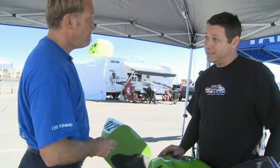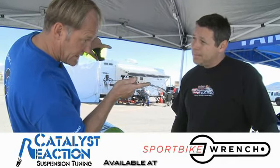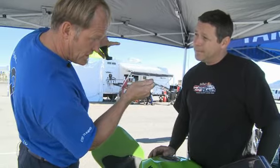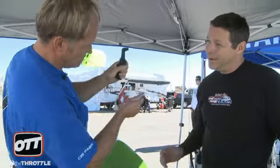So you're looking for the pop after the trail brake? No pop. Zero. Just bleed it off, let it go, and as you're bleeding it off — if you're doing both together — it should just rise. Mid corner out you've got all that. The only thing I'm worried about is a sudden geometry change, because if that happens and it hits on a bump and goes pop, you're going to get either that, or worse, that.